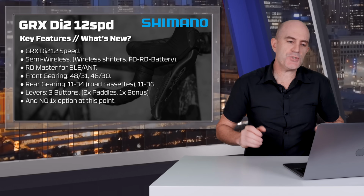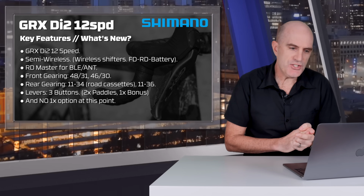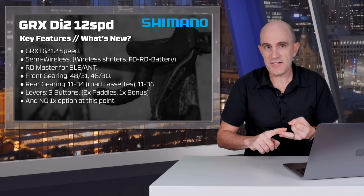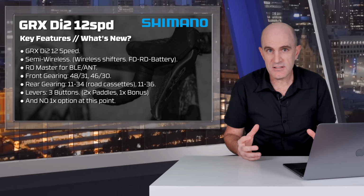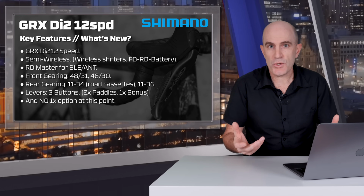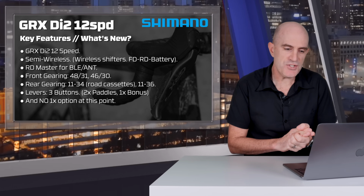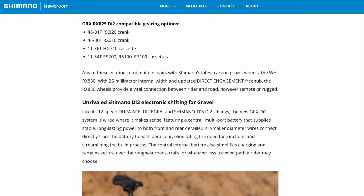Okay, that aside, key features, what's new? 12-speed Di2 semi-wireless. So the front shifters are wireless, the rear derailleur, front derailleur, and battery are all wired together. The rear derailleur becomes master, which also has the inbuilt wireless module for ANT+ and Bluetooth. Two chainring combination options are listed, given it's 2x: 48/31 and 46/30. When it comes to the cassette, a number of road cassettes are compatible, so 11-34 up to 11-36.